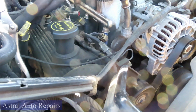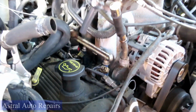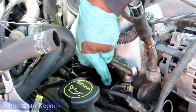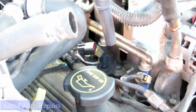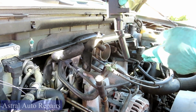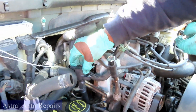All right, first, where the spark plugs go, right there, make sure you're lining up. There's the hole right there where we put the bolt to hold down the coil. You notice how the coil has a bend to it? That bend part that swerves inside, you're gonna make sure that's going in towards the engine. So we're gonna push that down.